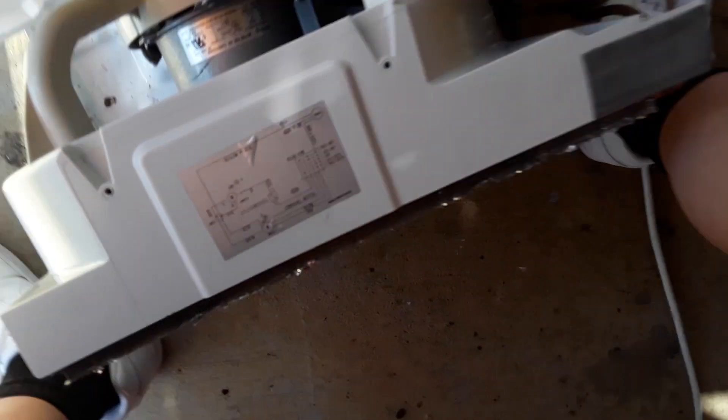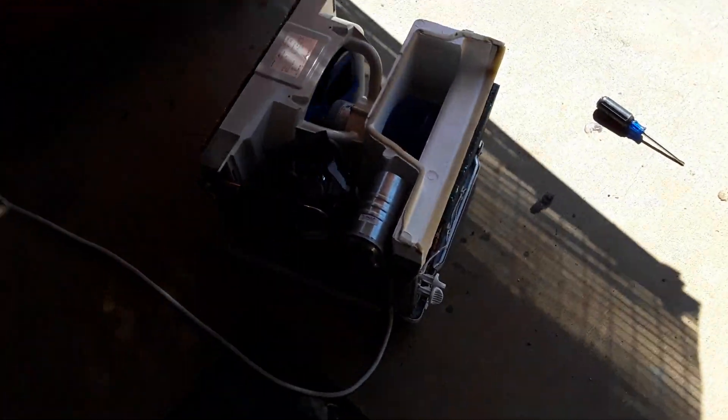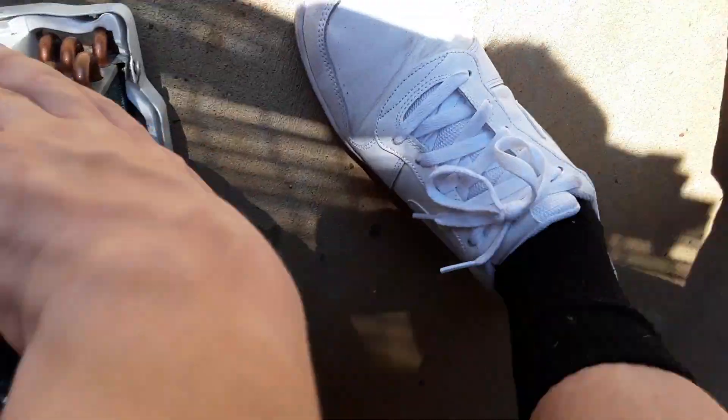Welling fan motor. I really wish they made the design where it sucks through the condenser and blows out — that would have been better designed and easier to clean. But I don't own the window air conditioner company, so nothing I can do about that. It's sweaty and cold — the evap is sweating now, everything's sweating, except for the suction line coming back.